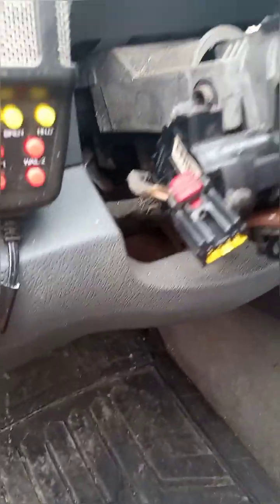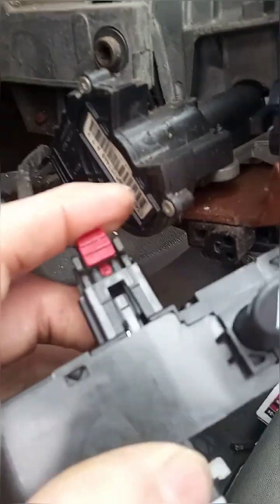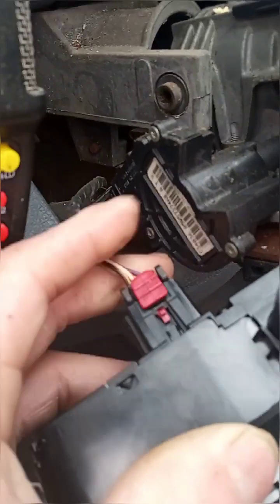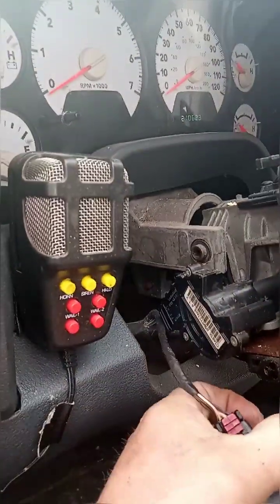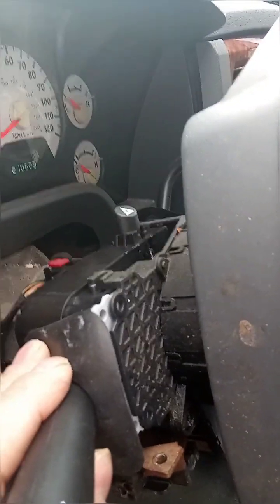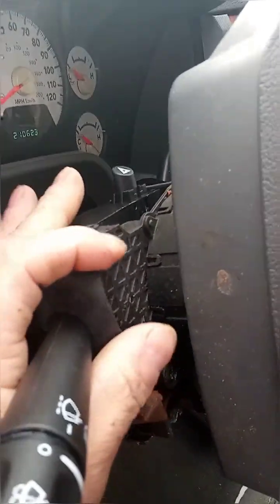Go ahead and hook up the electrical cord — just snap that in. Make sure that red lock tab locks. Once you have confirmed it is all the way in, give it a little pull to make sure it holds. I have got my blinkers on and blinkers are working great. Now that I know that works, I slide it in — snap. It takes a little wiggle, and once you have got it wiggled in you have got it locked in.